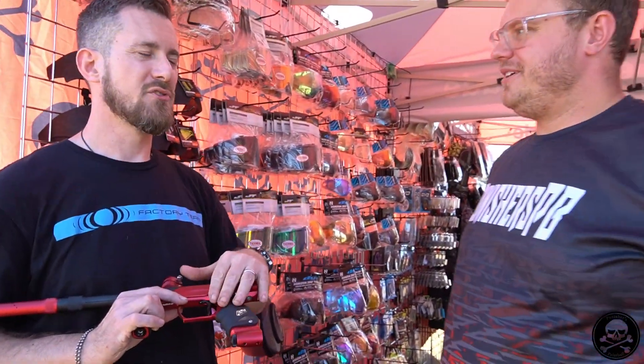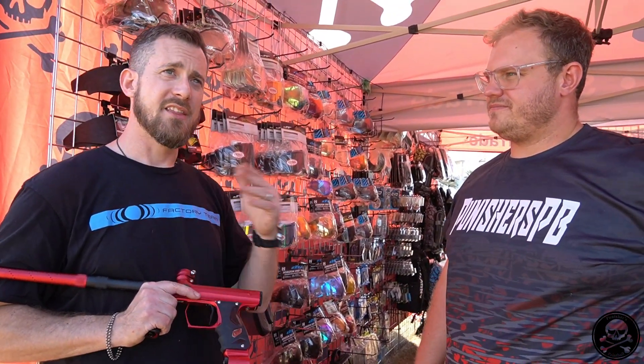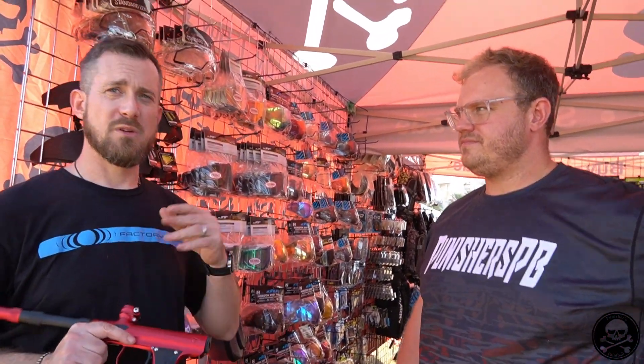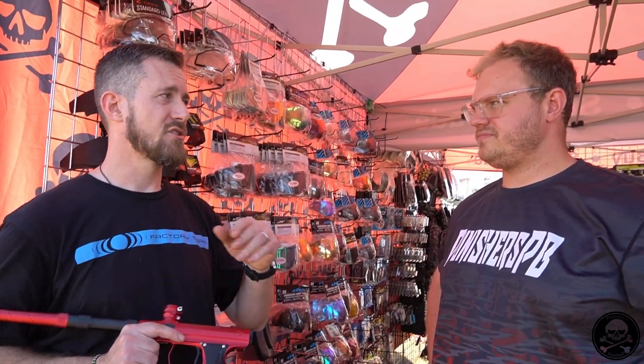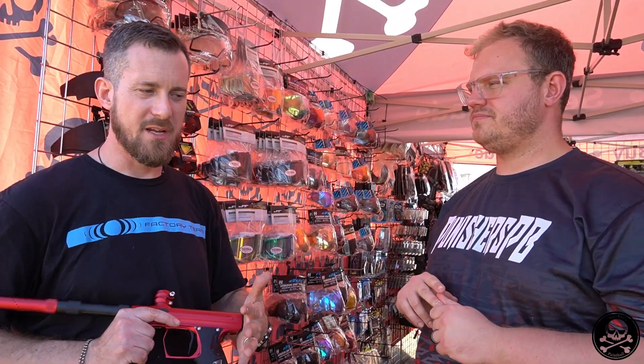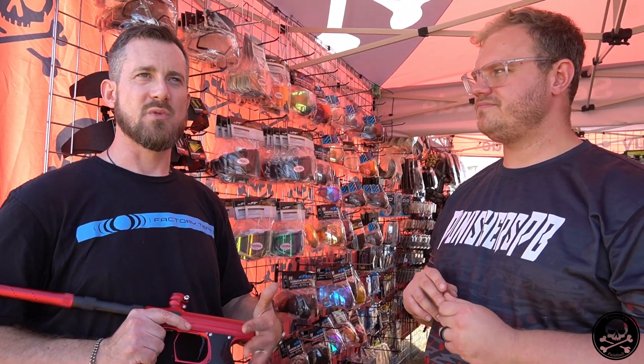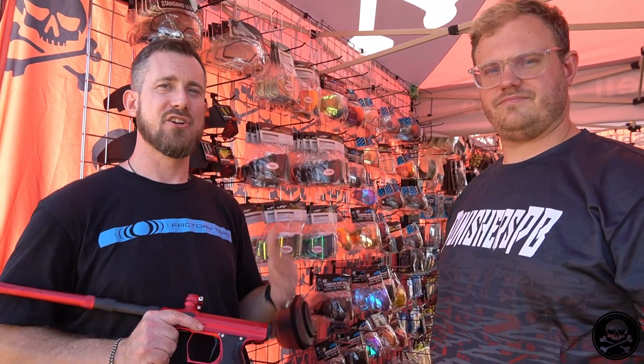The board has been redesigned, and that's one of the reasons the trigger feels so nice. We've gone to what's called a long-arm micro switch — the micro switch is about twice as long in the lever as it was before. In doing that, we're able to put a wall behind the micro switch, so one of the more common errors — a player misadjusting the trigger and damaging the micro switch — is eliminated. Now, regardless of how you adjust the trigger, you're not going to damage that micro switch.